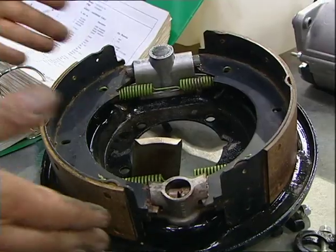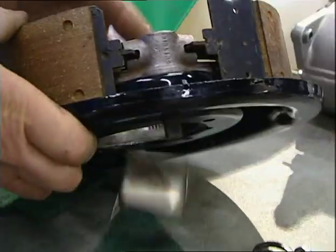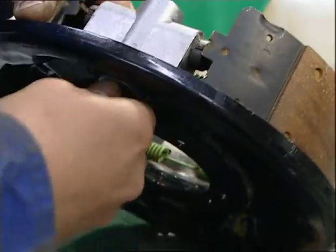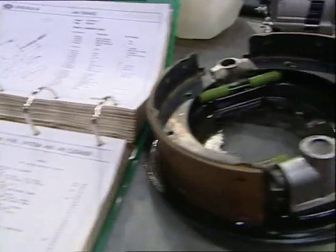It's a very efficient handbrake, but there is one problem: if you jack up one rear wheel, the handbrake wouldn't work at all because the diff would allow the whole thing to move — so be warned if you have a transmission brake. You can see the difference between the four-cylinder bracket and the V8 bracket — I've painted up the V8 one, it looks beautiful, completely refurbished. But they are very different — it's this bracket that fixes to the back of the gearbox that is very different. That is going to slow us down considerably.